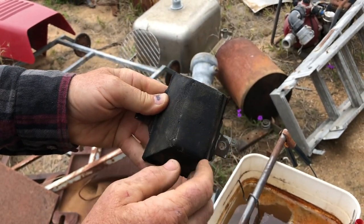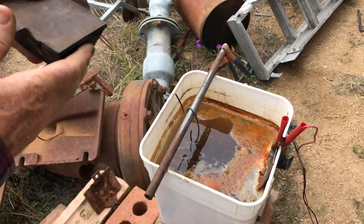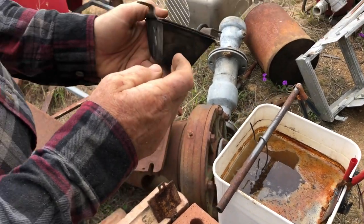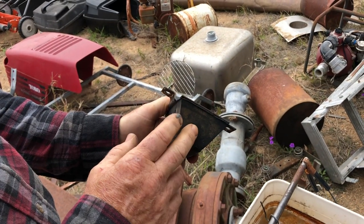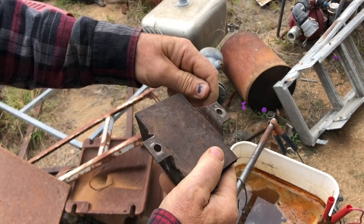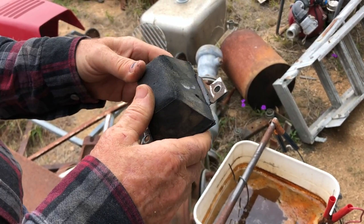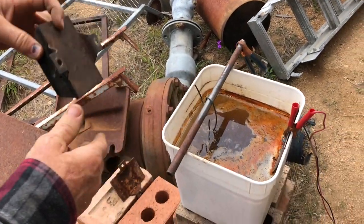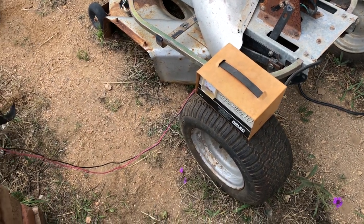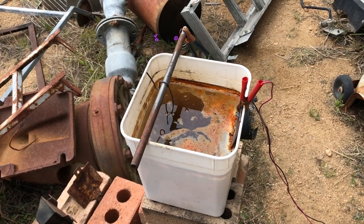The rubber cleaned up nicely. The electrolyte doesn't actually eat the rubber. So what have you used — sodium hydroxide? No, sodium carbonate. Washing soda. Sodium hydroxide isn't so good for rubber — no, it's not. This one however is a bump stop in poor condition because you can see with the rust going, there's a great big crack along that edge there. This is one of our scrap spare ones I could afford to experiment on. You've just got that hooked up to a little battery charger — yeah. We're going to set up a slightly bigger one, although that seems to be working just fine.